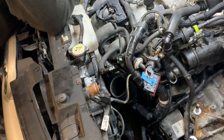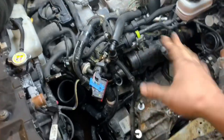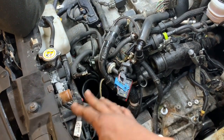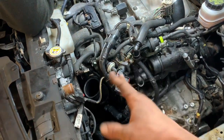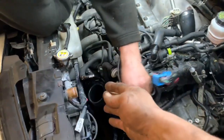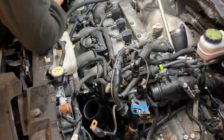Something you need to do during this process is remove the fans. With the motor mounts out of there, the engine can contact the fans as it drops. I think we're going to be okay, but I don't want you to damage your stuff. Before you do it, remove the whole fan assembly, the radiator, cooler, reservoir, et cetera.